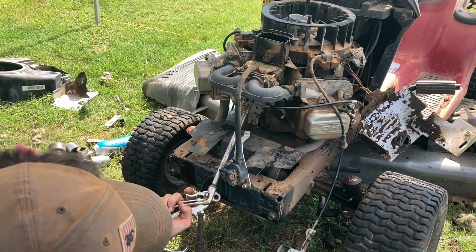Like that oil is just getting right past those rings or what, but God, it's burning like insane. I think I know where it's coming from. When I sprayed that oil down in the combustion chamber and used the air hose to blow it through, obviously it would have gone all over the inside of the muffler and the exhaust pipe. So it's probably just burning it off, hopefully.